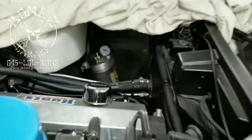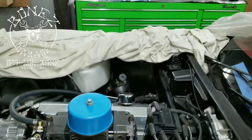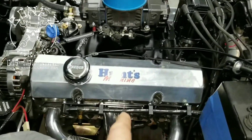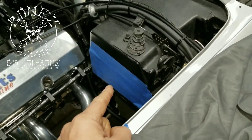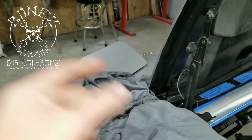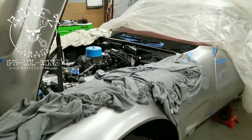A lot is getting done, a lot is getting finished — the car is going to look beautiful. If you look down in that little corner right there, there is our vacuum tank. We had to put a vacuum pump in this car; it's located right behind and above the rear wheel inside the well on the passenger side. We really needed that because the cam in this motor is so big that it will never produce enough vacuum to run the power brakes, and we also have vacuum-operated headlight doors. I'll talk to you real soon — have fun, bye!